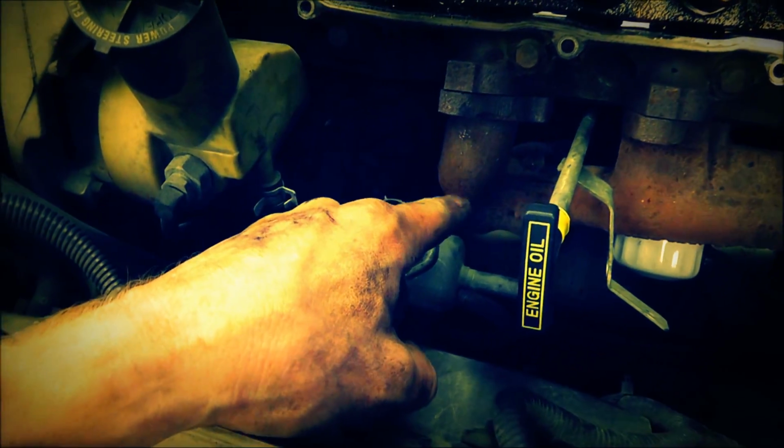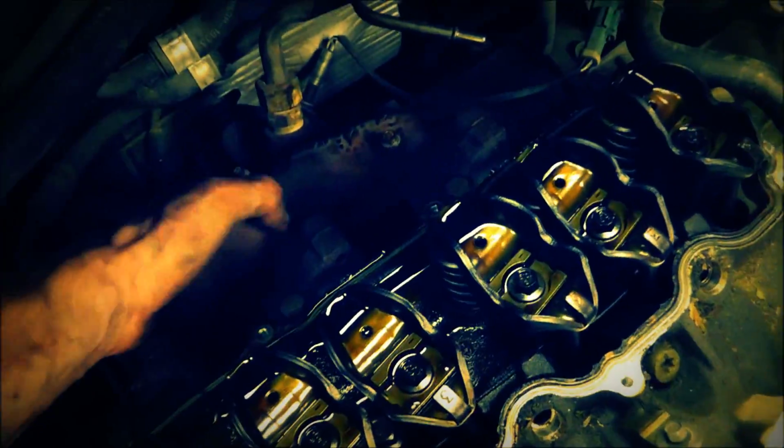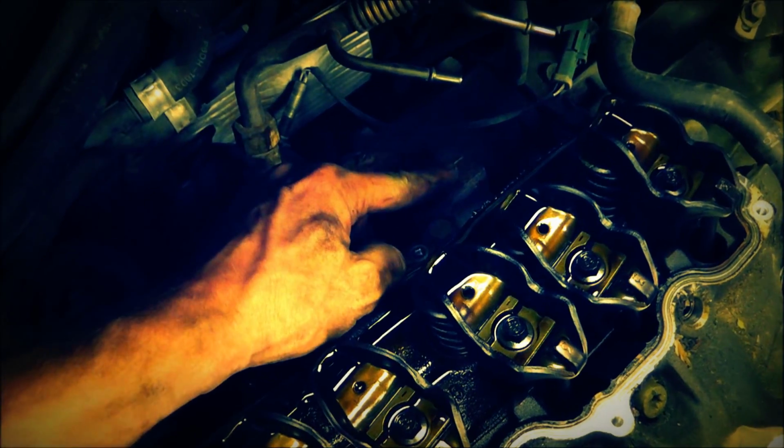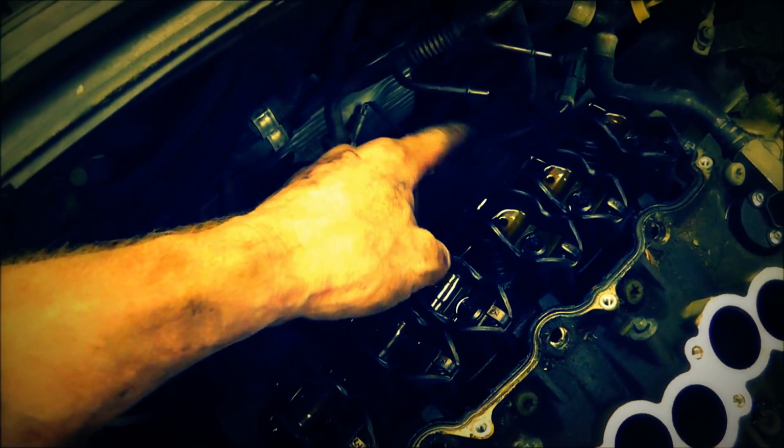Alright, so I've unbolted the exhaust, and I'm going to try something. Without unbolting the manifold to the pipe, it's loose enough that I think I can just pull it away to get this thing put together and taken apart. Now, that's great for the front, but for the back, I took all the bolts out, and this one right here didn't even have a head on it. It's broke flush. So the manifold's still loose. And if that's the case, if I can still get the head off, and then I can take the bolt out afterwards, I'll be okay. Otherwise, I'm going to have to take this whole thing off. But this here, I just turned it out of my way, and hopefully I can just tighten it back up, and it's in the right spot.